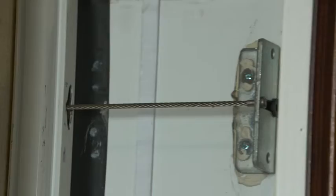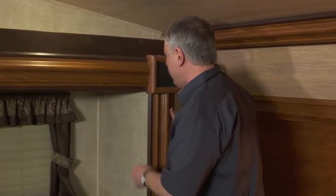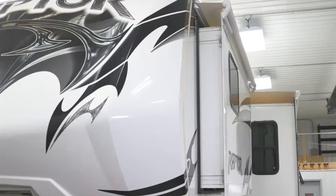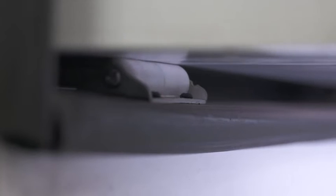It's just a gear at the top and it'll pull these chains, which in turn pull the cable. On the side of the flange we have a cable on the top and on the bottom, hooked to the inside — same thing on the outside flange. So it's going to pull the room in and pull the room out, running off rollers on the bottom side.